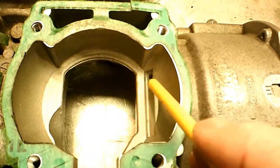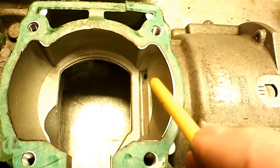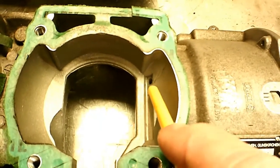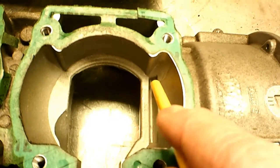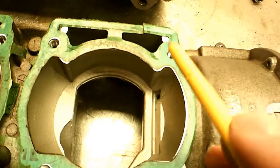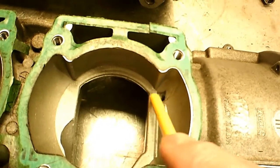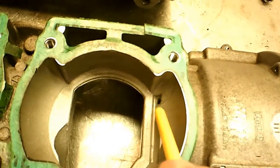Your fuel mixture is going to go through here and up through these transfer ports pretty fast. My theory is that the air passing over this hole is going to want to draw oil through there. The oil will come up through this hole and go up through the transfer port. Whenever the ports open there's going to be a rush of air across that hole, therefore it'll make a low pressure and it should suck stuff right through there.